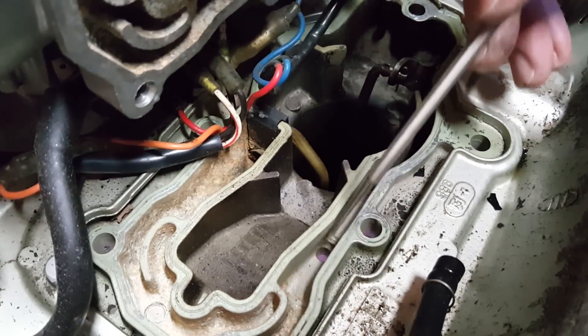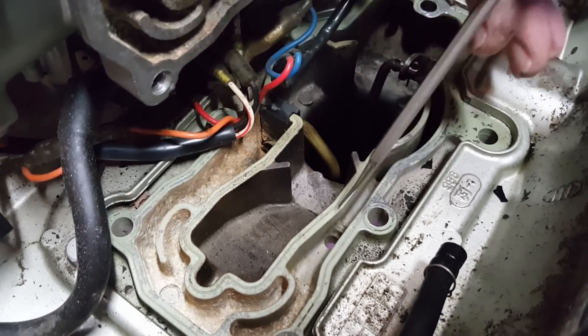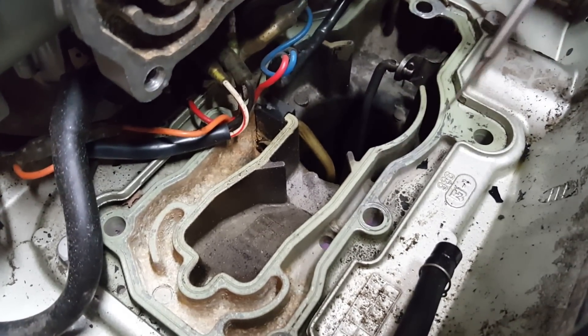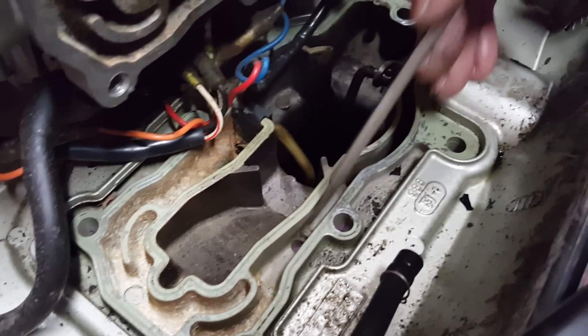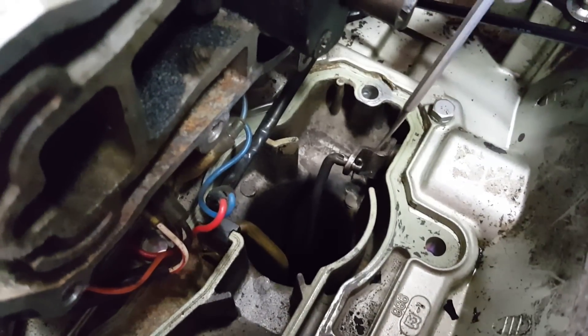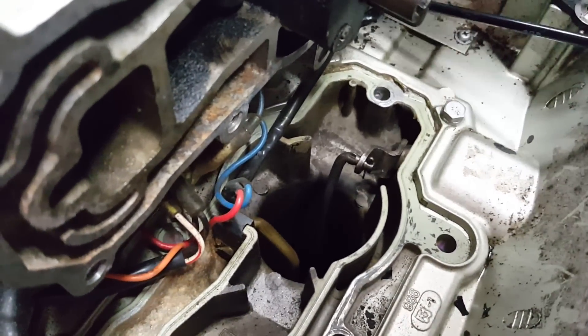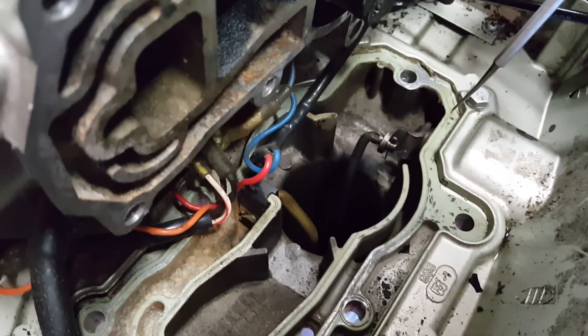Notice that the hot water coming out of the engine does not only go through that hole. If you don't see water coming out of your telltale, you might have a clogged nozzle — in which case the hot water can also go over this dam, through this passageway, and down through the exhaust tube. So hot water exiting the power head is going both through the telltale and through the exhaust tube.